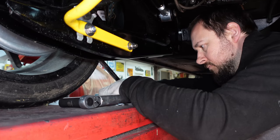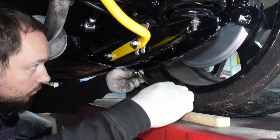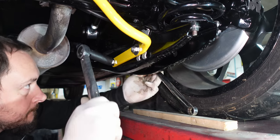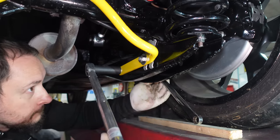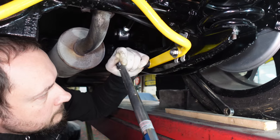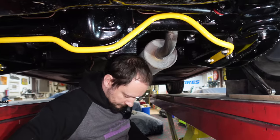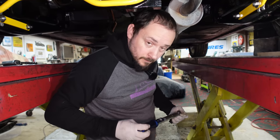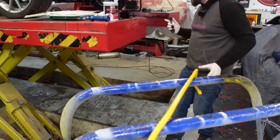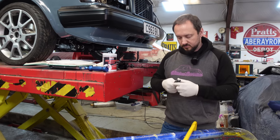That's more like it. Make all the noise in the world. So that is the bar torqued up. We're going to go through and check all the other rear torques now, and then we'll go around to the front roll bar. We're going to put all the bits and bobs on the anti-roll bar nice and loose, and then offer the whole thing in in one hit. So let's get greasing — we'll grease it all up, slap it in, then tighten it up.